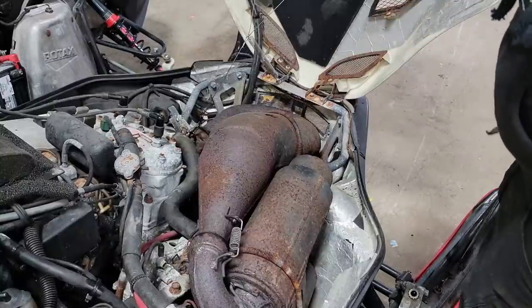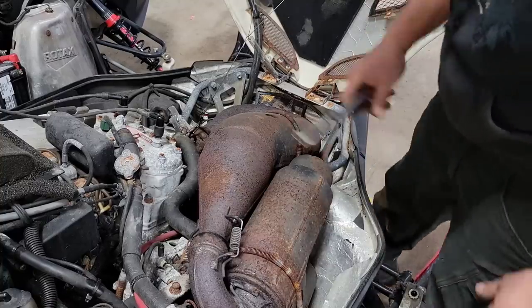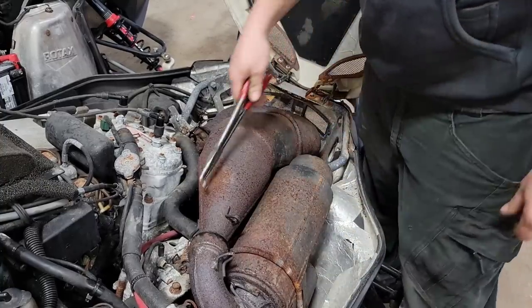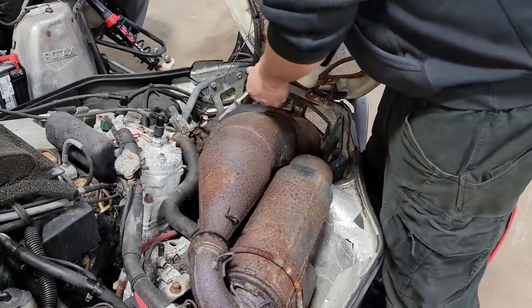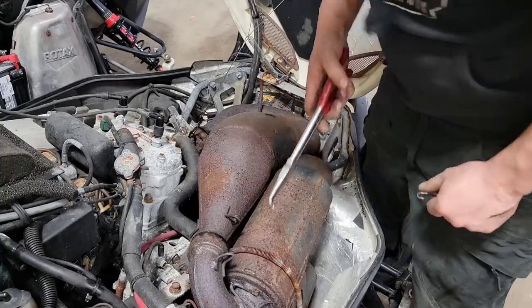Let's move over to the VMAX and do plugs and try to get that recoil out of there. This exhaust is doing a better job than Johnny Bower blocking the net. If we want to get that recoil out we've got to strip this right out. I use these hose pliers — they've got a nice little hook end on there that grabs the springs perfect and makes easy work of getting these fellas off.